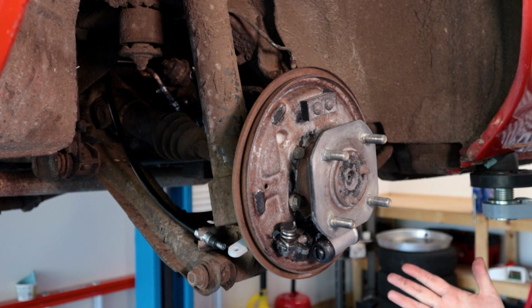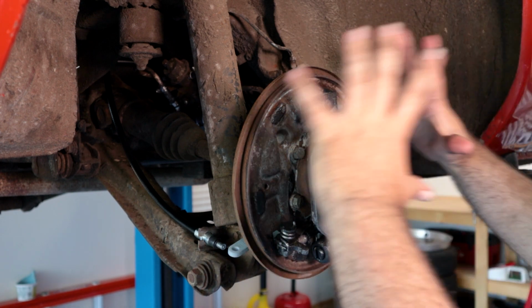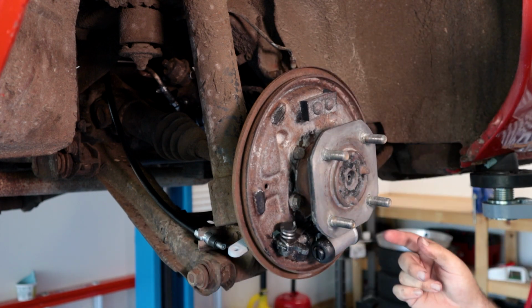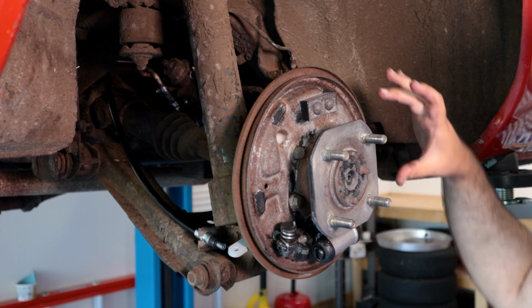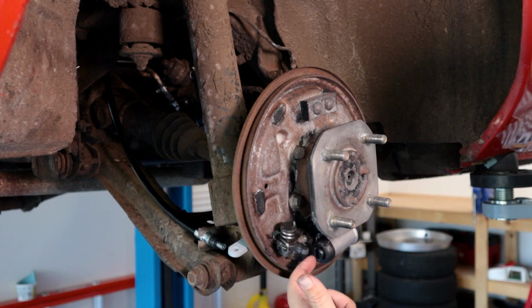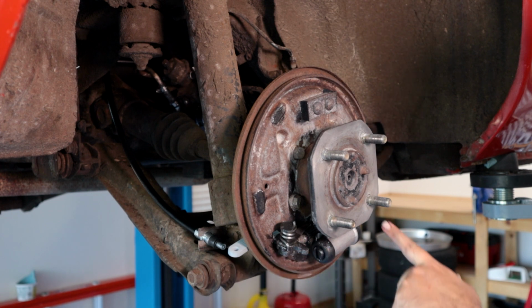So what I found, really, the next part is you're going to need some pliers. You're going to need all your bits and pieces at hand, because once you start setting this up there, you're going to have to start holding it and getting the springs adjusted, and it becomes a real pain. So having all your parts handy so you can grab stuff. What I found is that if you're putting the front shoe on, where it needs to go into the parking brake adjustment, at least you got to get into 2 slots plus the top. The back side, you just got to get into the slot, then you've got to get over this little nub for the parking. So that's a little easier to do than trying to get these two.